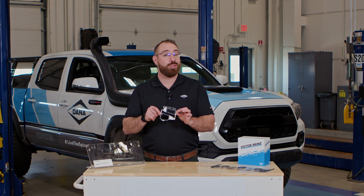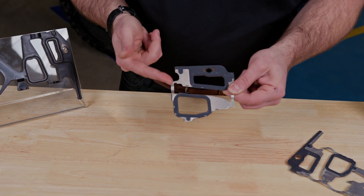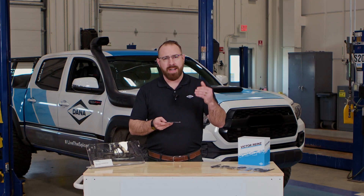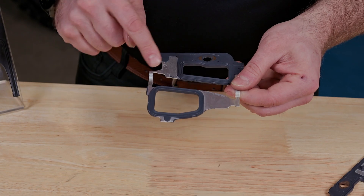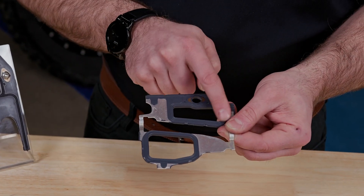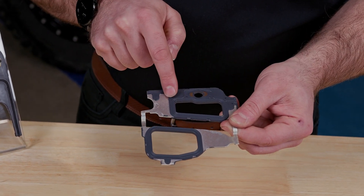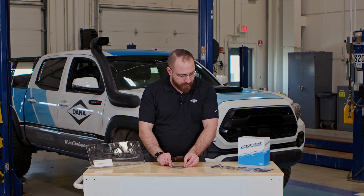What we have here is a premium solution. This MaxDry STL has a rigid metal carrier that will not corrode or break down when in contact with older coolant technologies, but we also have a molded rubber gasket that is in this metal carrier. You can also see that we have raised beads that provide that optimum sealing surface when you're talking about an intake manifold.